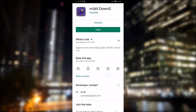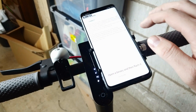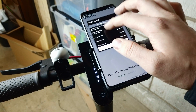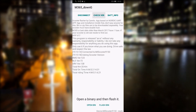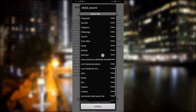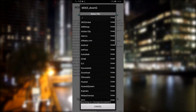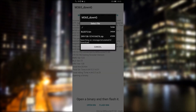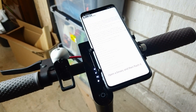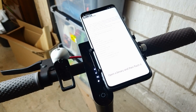Turn your M365 on, open the app, and connect it to the scooter. For me I had to hit 'Check Version' twice to get it to recognize properly. Hit 'Open BIN' at the bottom of the screen and find ble072.bin in your downloads folder, then hit 'Flash BIN'. Once the flashing process is near 100 percent you'll hear the scooter make a bit of a concerning sound, but don't worry — that just means it's done.